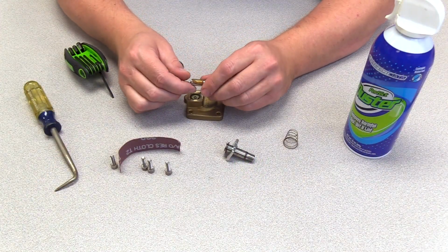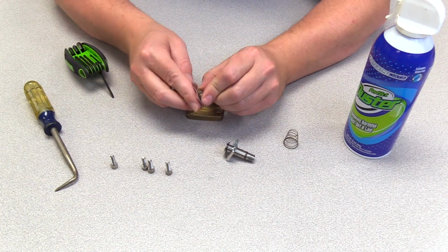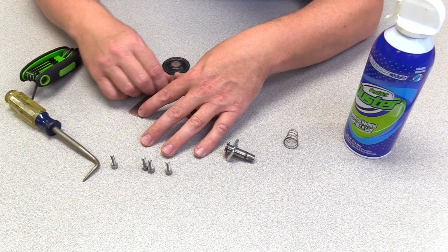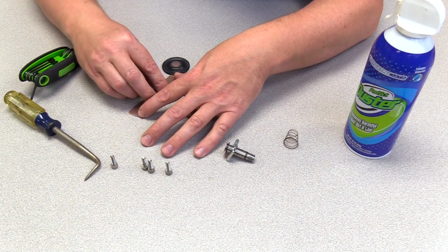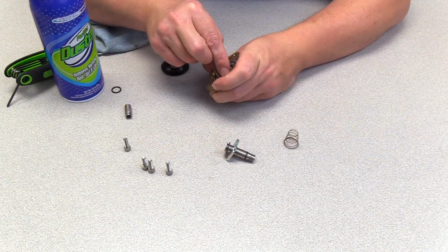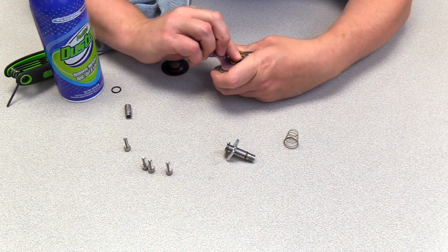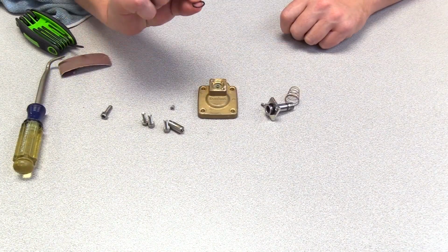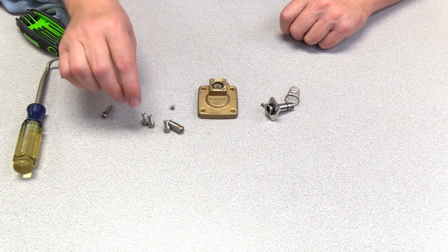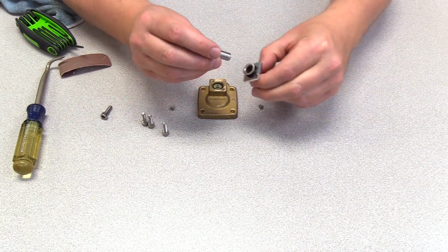Clean and remove any foreign objects on all the valve parts. Rinse with water. If there is corrosion on any parts, clean accordingly. Reinstall the plunger into the valve stem and secure it back to the valve top. The spring on the valve stem will be facing up.